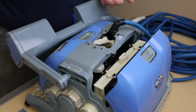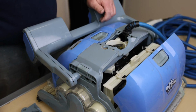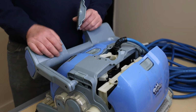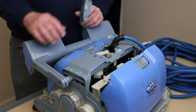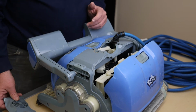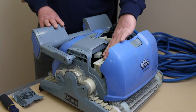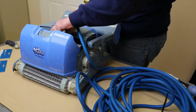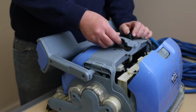Sometimes when you go to inspect and clean the impeller, you may notice that a fin is broken off or there is other damage. This is no doubt a scenario for replacement. The broken part would be located internally, nearby, or it could have fallen out. The filter does a good job of keeping most debris away from the impeller, so it doesn't have to contend very often with large items that could break it. Because of this and other reasons, impellers do typically last quite a while.